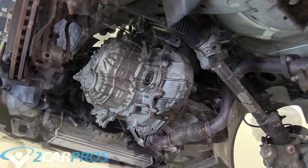Now we're going to place the cradle back. I've got the cradle back up here supported by the transmission jack — if you're doing this on the ground you can just stack wood to make it a little easier. I'm going to do all the bolts on the cradle by hand, cinch those up by hand first before I tighten any of them. I'll do a quick walkround to show you what the cradle looks like reinstalled. I went into pretty good detail when I was taking this apart, so putting it back together is the exact same thing in reverse. There's still a plastic skid plate here I need to put back on, but this is what it looks like all nice and back together.